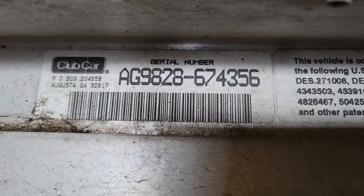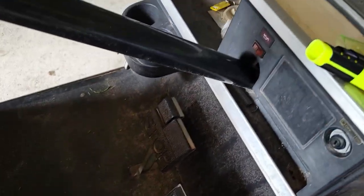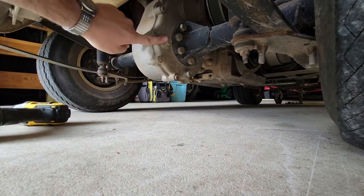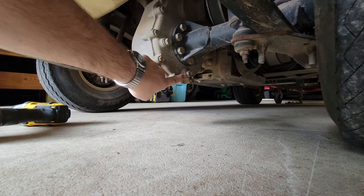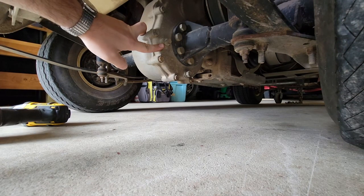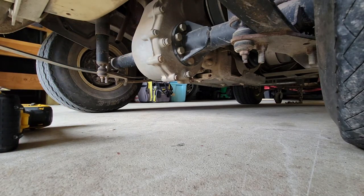There's the sticker. Make sure it's off. The two bolts in question are the fill plug here and the drain plug here. These are 14 millimeter — nine sixteenths was too big and 14 millimeter is just right.